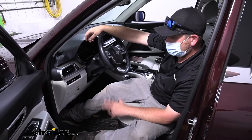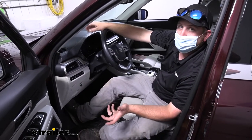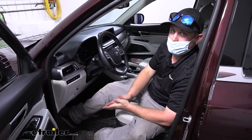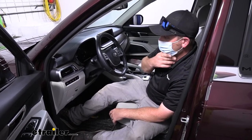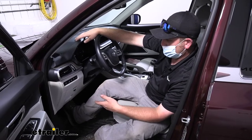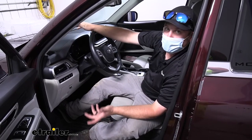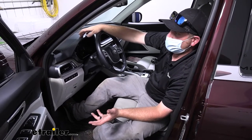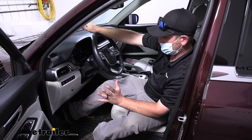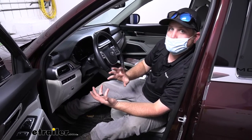One of the nice things about this setup is that it is a proportional type brake controller. What that means is it's going to provide you with a more predictable and smooth stop, which is important. You don't want to be getting pushed around or really fighting the trailer as you're towing it down the road. More or less, proportional means the trailer brakes are going to brake at the same rate that you're pushing the pedal down inside your Kia. For example, if you're rolling up to a red light and you're barely on the brakes, the trailer is going to do the same thing. On the other hand, if you're going down the interstate and have to come to a quick stop and really stand on the brake pedal hard, the trailer is going to do the same thing. It kind of becomes a part of your car almost, making it easier to drive and tow.